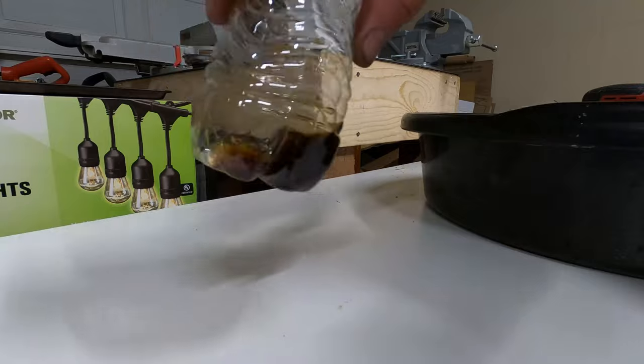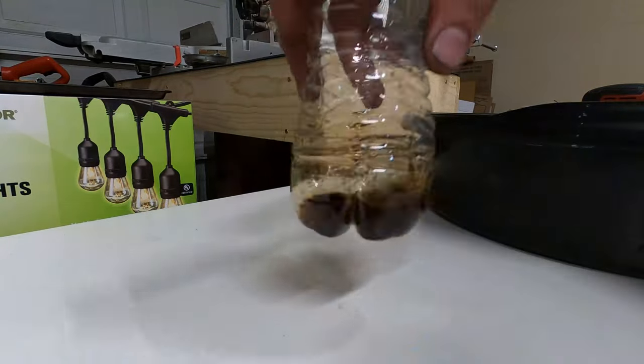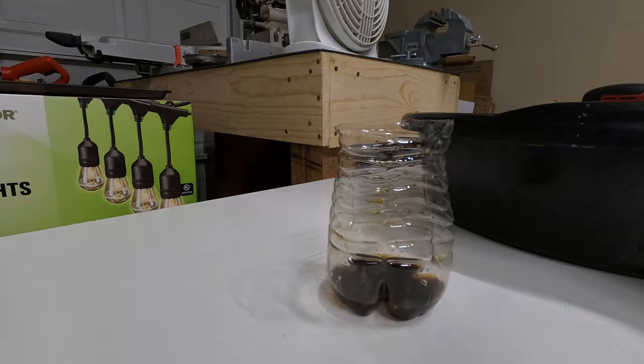Looks pretty bad. I'll probably have to put more gasoline in. I didn't put very much in, maybe like a quart. Okay, I put a gallon of gas in the gas tank to soak overnight. Kind of swished it around. I'm gonna check the cylinders now and see what they look like because I have that borescope still. Let's pop those spark plugs back out and take a look.